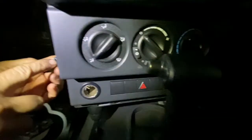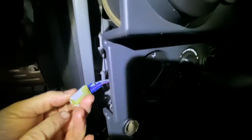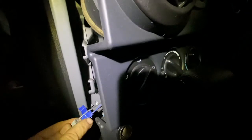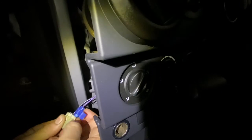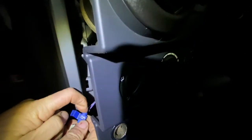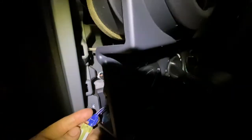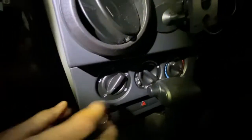On this particular model, if you come in the back and unplug the cigarette lighter, you're gonna see a plug like this. When you shut the car off, there's no power to the cigarette lighter. The black is ground, and the blue with the pink stripe is switched power. That's where you're gonna connect your red wire from the wiring harness, which I'll show you in a little while. You're gonna use one of these connectors — put the red wire in, squeeze it down, make contact on both, so you don't have to cut it. That gives you a connection, and you just plug it right back at the cigarette lighter.